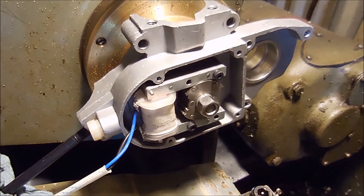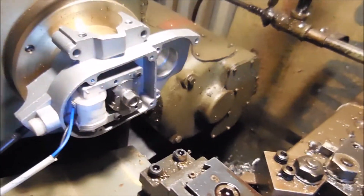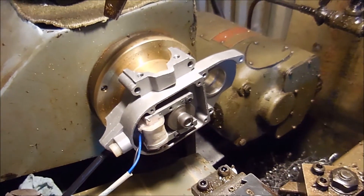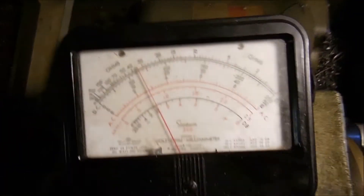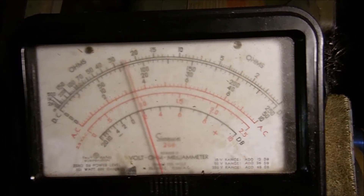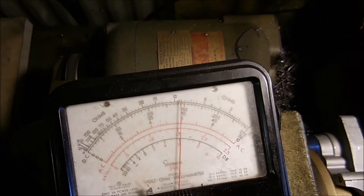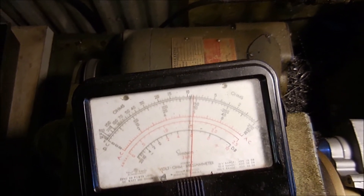Now I've got the two-wire blue and black wire magneto — the stock magneto. I'm going to turn it on. At low speed we're at about 65 volts. Going to turn it up to full — and she's about 125 to 145 volts.